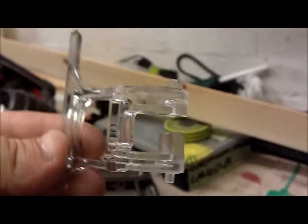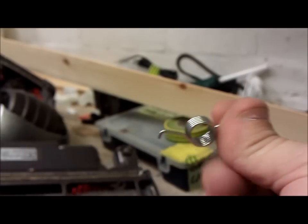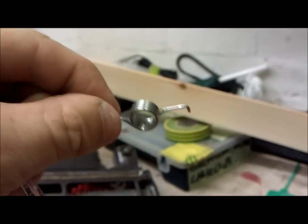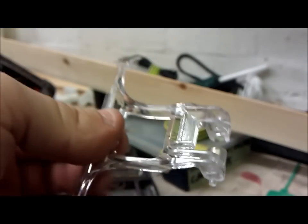That's the plastic lug again — large lug on the top, small lug on the bottom. There's the spring. You want to fit the spring to the plunger first. The little leg on the spring fits into a small groove, which I'll quickly show you now.